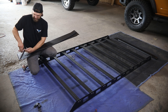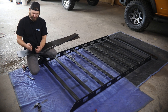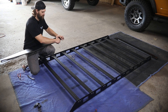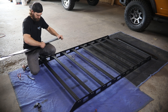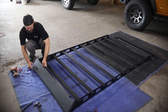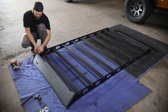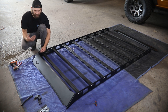Save the cut end as we'll use that on the rear fairing in just a moment. Make sure once you've cut this, if any of that aluminum is sticking out of the end, get it peeled out and thrown away so it doesn't make contact with the fairing or the paint once installed. Once cut to length, start at one end and using a little bit of pressure, push it up onto the fairing. Once pressed on, the fairing can be installed to the rack — it simply slides between the two side rails and bolts in with the same quarter-20 button heads and washers, with serrated flange nuts on the inside of the fairing. We're just doing the top and bottom bolt on this front fairing for now.